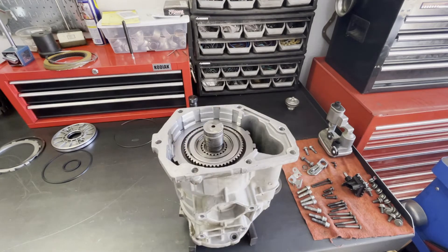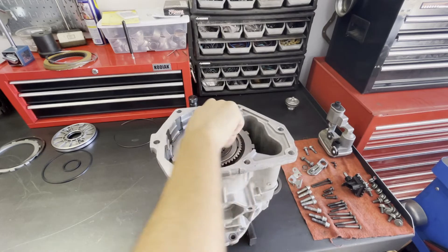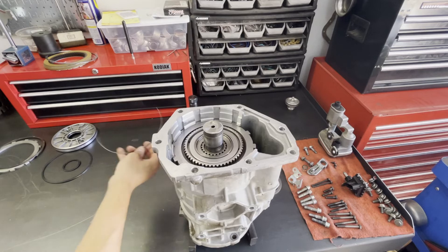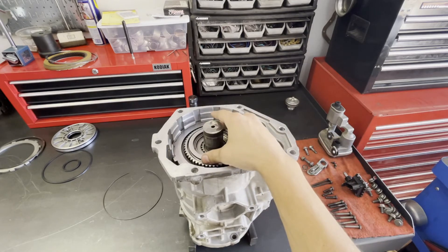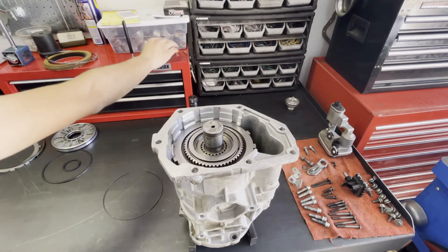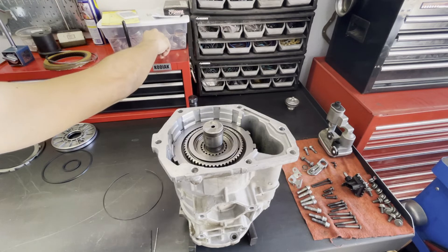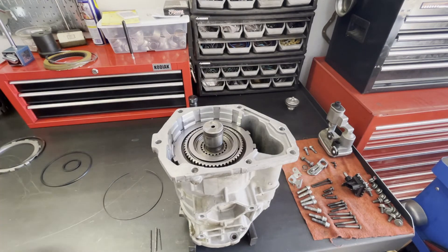The last thing in should be your steel plate. Just turn it, make sure everything is still good to go in there. For now we're going to leave that wire retaining ring out so that we can measure our clearance. The first thing we want to do is install the original spacer and then grab our drill bits. Ideally we want to see between 90 to 110 thousandths on the clearance.